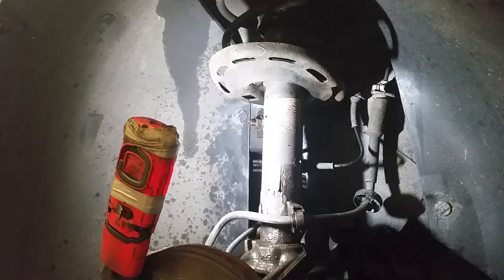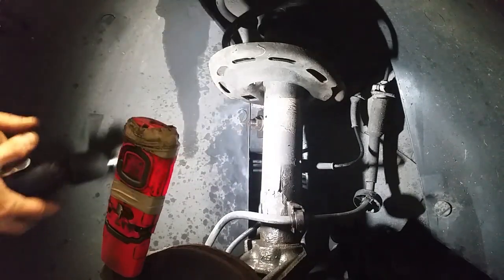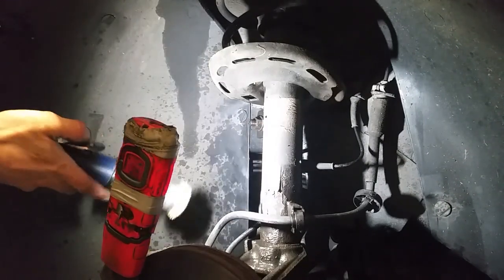So, you have your roll bar drop link bolts and tie rod end bolts, all rusty. These things here give a lot of trouble. People struggle with them. They have wee Allen keys or Torx bits in the heads, and they'll just grind and strip on you if you put any force in them. So if these threads are rusty at all, you'll find yourself struggling with some of the roll bar drop links. You maybe end up cutting it off.